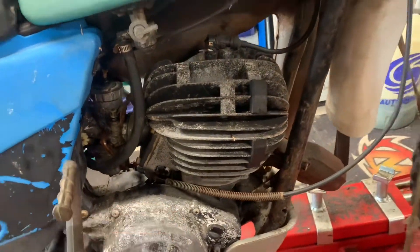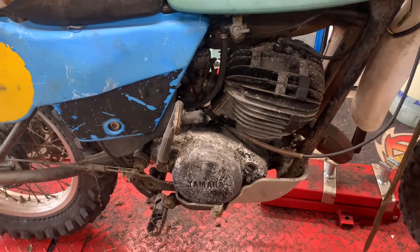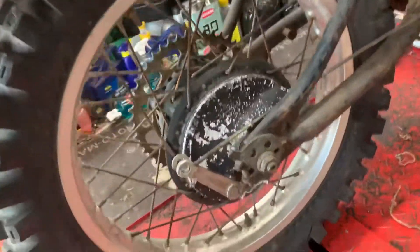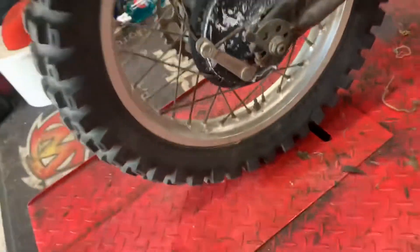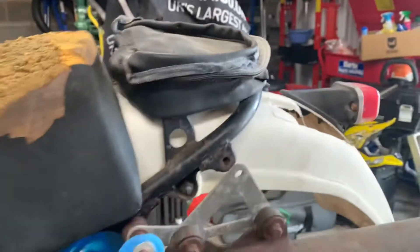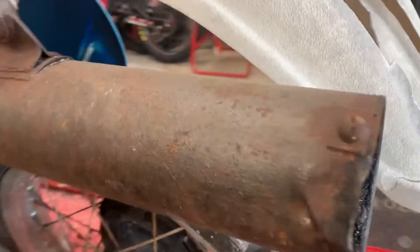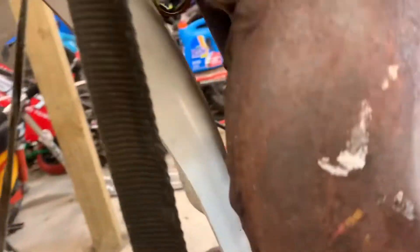This white on the engine casing will just brush off really. These were magnesium casings, and in the container with the salt water they always go white like that — same with the brake plates. That rear wheel, again, that's looking nice and round. No dents in it. It doesn't even look as though it's had many tyre changes — you can normally tell because they're scuffed. The exhaust itself is okay. The front pipe has got a few dents and bashes on it, but she's all together.